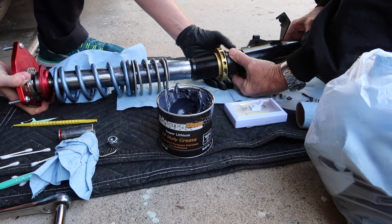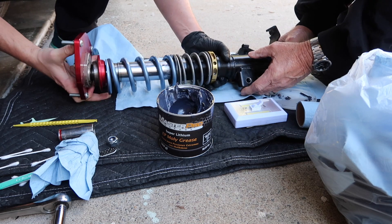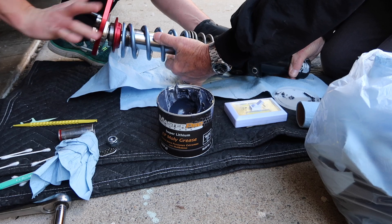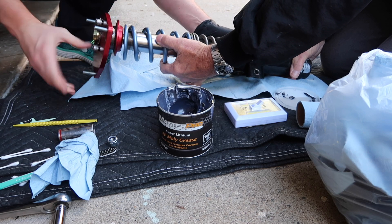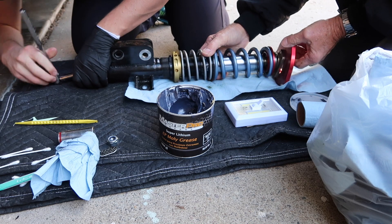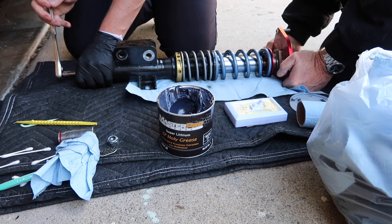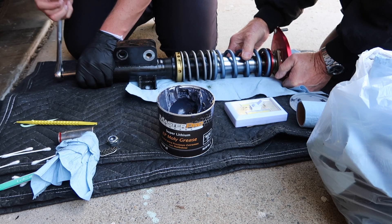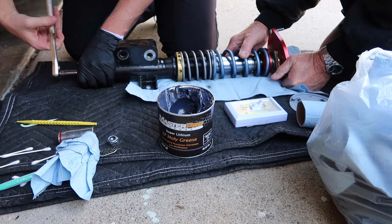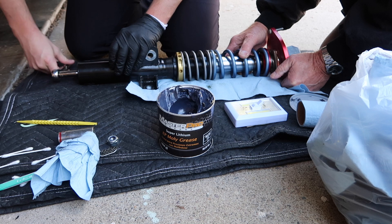You insert it right here but you want to be really careful about your dust seal at the top to make sure it doesn't get deformed. This is reverse thread so lefty tighty, which is kind of awkward. You want to start this by hand before you get a wrench on it — you do not want to damage the threads. I couldn't find a specific torque setting but it's not very tight at all, basically about a quarter turn past tight. It's quite a long fine thread so it takes a little longer than you think. I took a simple measurement from the top of the collar here just so I could reset my ride height easily.